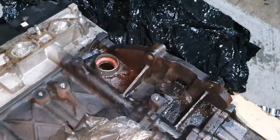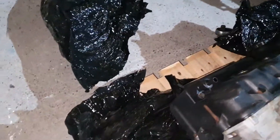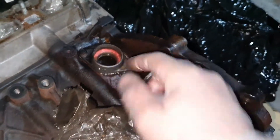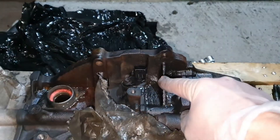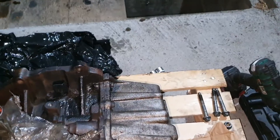This is the new engine. We have the pulley which is perfect because I don't want to do this job again. We are going to replace this sensor because we have a new gasket on the other engine. We are going to check if there is a leak somewhere and replace this one — there is a little deposit from the coolant. Other than that this one seems dry. In here we have oil because all the Minis are leaking here from the crankshaft position sensor.